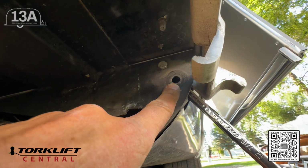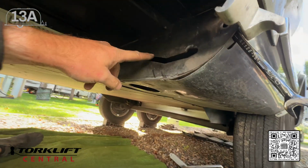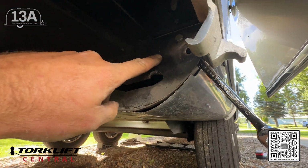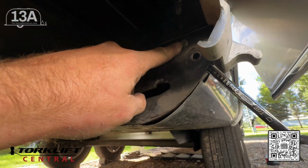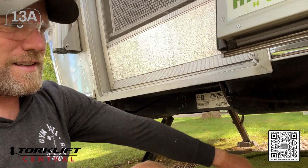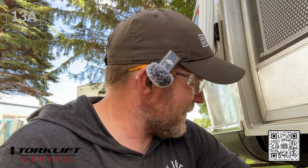The bolt hole right here, that's one that comes out, and then the one that's in here comes out. So this is the one for here, and this is the one for right there. So I still have to take that little bolt out, which pulls this whole thing out, and there's one on each side. So taking out the step is a pretty arduous process, just because it's limited space. They put this thing on before they put this banana trim down here, when they have the frame upside down and can tighten everything down.